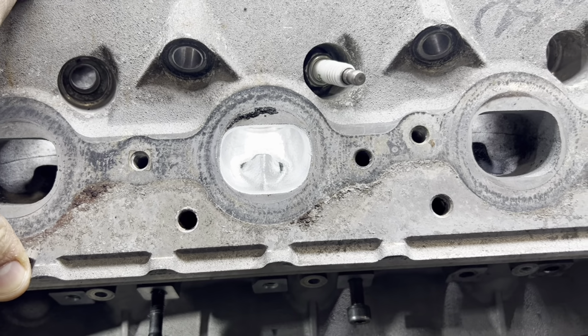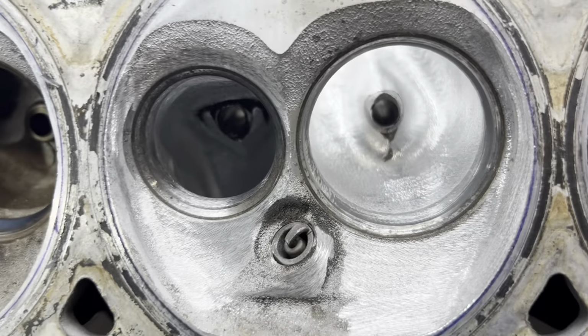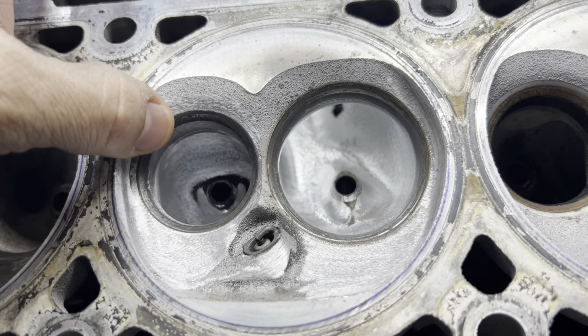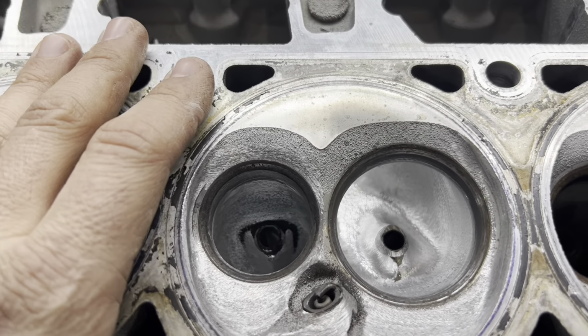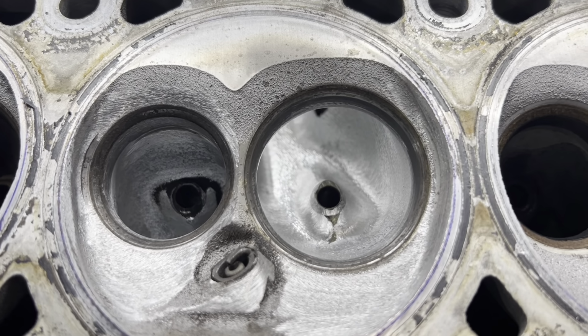Like I said, the other thing that I did here, I just blended all the ridges, and I didn't even open it up to a 4-inch plus bore. This could very easily work on a 5.7, 5.3.